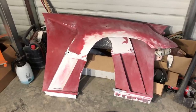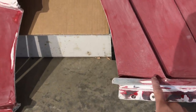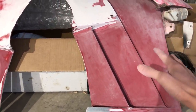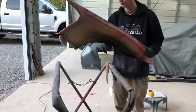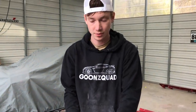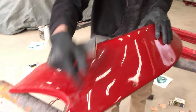We just completed both of these fenders. We did all the repairs that were necessary and it turned out absolutely amazing. We fixed that little crack in the fiberglass fenders — it's all sanded down and almost ready for primer. All it needs is wax and grease removed, but that's going to be in a later stage. For now, we're going to start sanding the other panels of the wide body with a 320. There's no major damage, just a little bit of paint chipping, but 320 should cover it and the primer is going to stick a lot better.